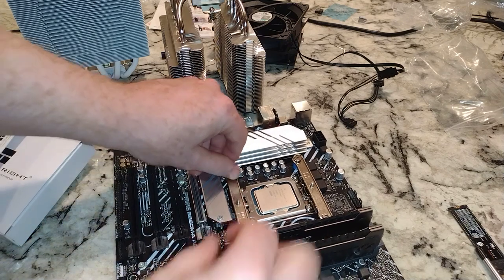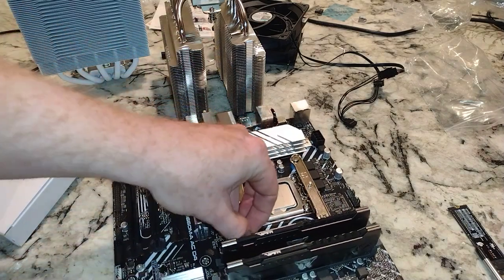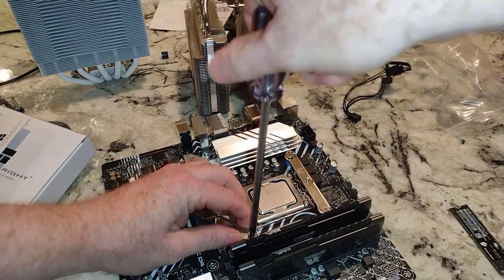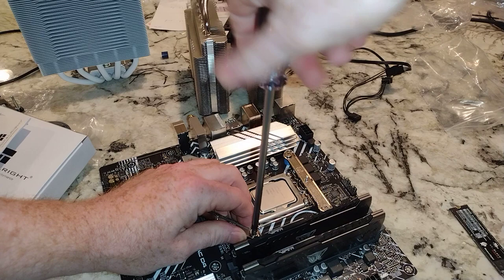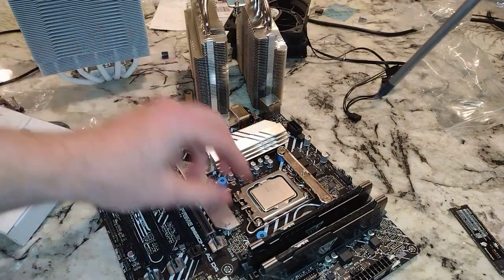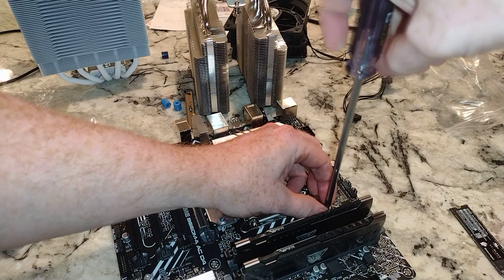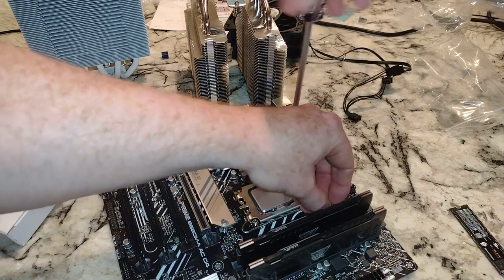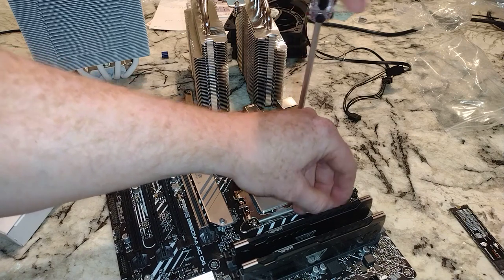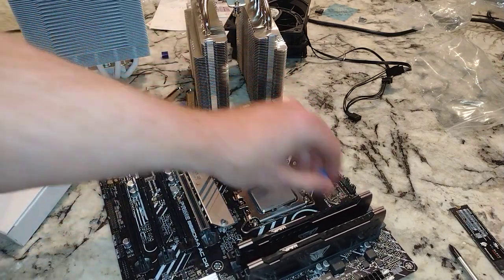Something I have found, as I've messed with more and more of these CPU coolers for 12th and 13th gen, is that you can almost get away with using some of the other mounting brackets from competitors — which surprised me. I was able to get the Aries Black Gaming CPU cooler — sent to us by Aries Gaming, but they don't support it for LGA 1700 — and using their brackets as well as some portions of Noctua's, I was able to get a bracket that worked.